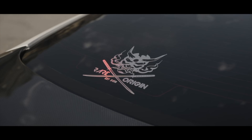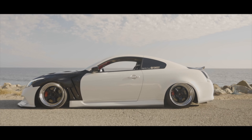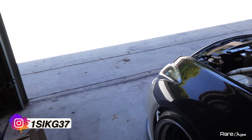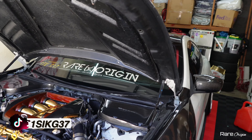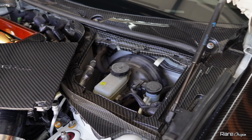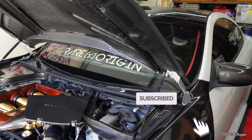Welcome back to the channel. So I've been having trouble with my clutch — we changed everything: went with a stage three clutch, two-piece flywheel, the C-MAC from C-Speed. Everything is new, and currently I'm having trouble putting gears in. What I'm thinking is, right here this is the master cylinder, and I'm not sure how the work was done. I don't even know if they bled the system — if they didn't, the system has air, and that's making the gears not go in.